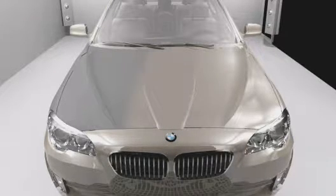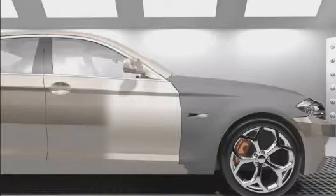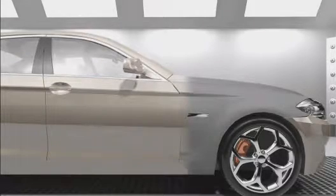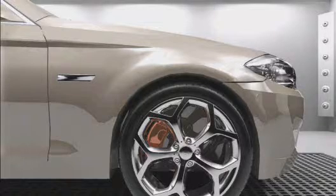Start on the left side and work to the right side of the hood. You may want to stop just short of the edge of the hood during low humidity to ensure there is no overspray on the fender. Moving quickly, complete the blend to the right door. Finally, paint the right fender, the last replacement part, knitting the color to where you ended on the hood.